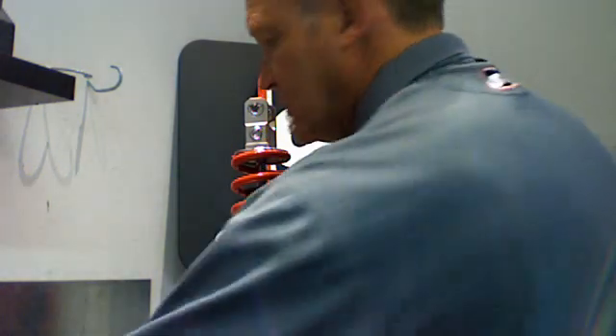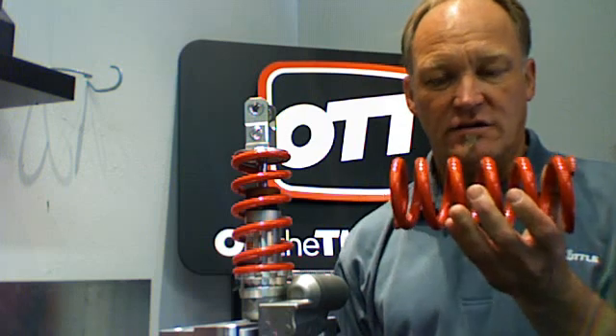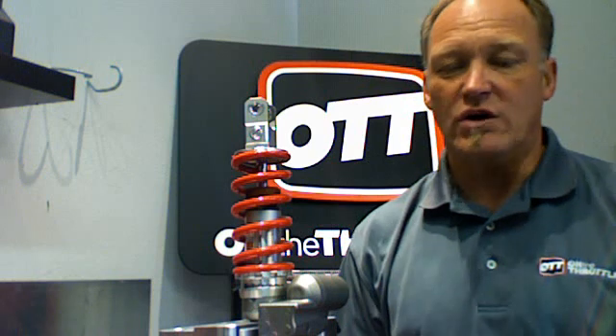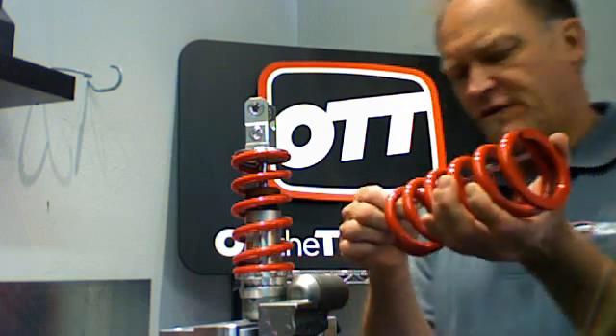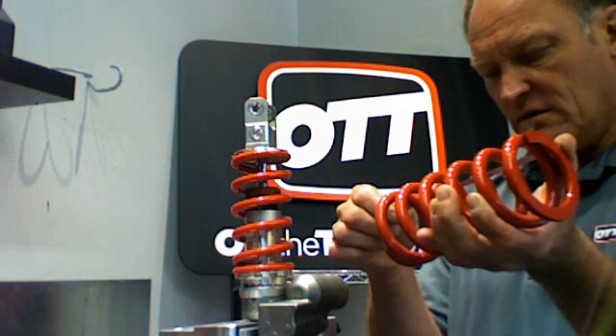We have in the vise a 2006-2007 Yamaha R6 shock. What I've also done is take our spring out of a second shock we have at the shop with Catalyst Reaction. This is an uninstalled spring. In industry terms, we would measure this to find what's called free length — the spring just sitting on the bench. The free length on our spring is 164 millimeters.